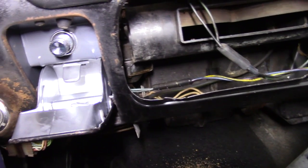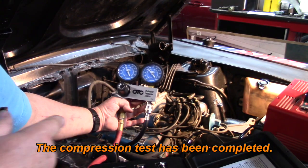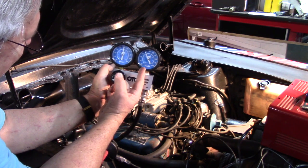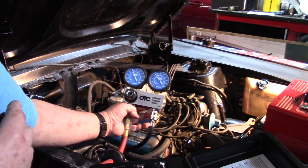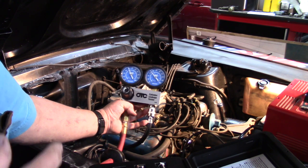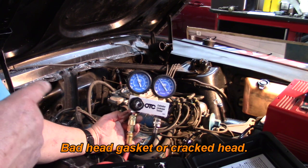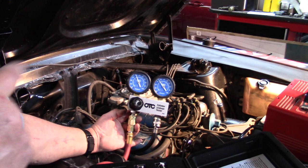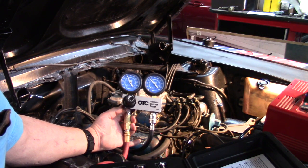While waiting for the battery to charge I installed the newly painted ashtray. On the leak-down tester, the left-hand gauge shows incoming pressure - you can't exceed 100 psi or the engine could turn over. I want the 50 psi setting. The engine started to turn over when I unplugged cylinder number four - the last cylinder on the passenger side - and the difference is about 5 psi, which is satisfactory. Anything more than that requires investigation. You listen for where air is escaping: bubbles in the radiator cap means a cracked head; escaping at the carburetor means an intake valve issue; escaping at the exhaust means an exhaust valve problem. What I'm hearing is air escaping in the crankcase breather, which indicates defective rings or worn cylinders.